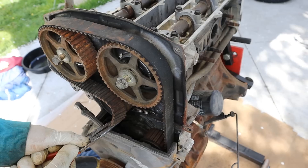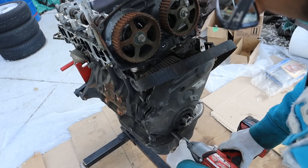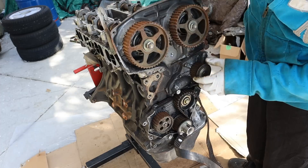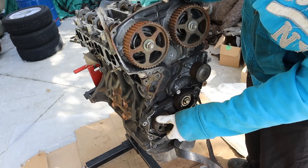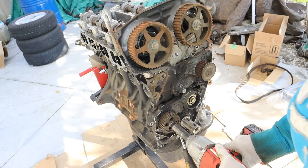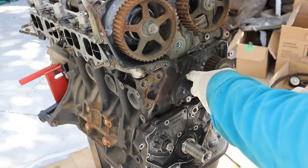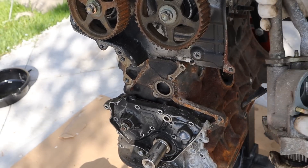I'll use the timing belt removal tool and the crank pulley removal tool. Taking a look at the timing belt setup: at the bottom we have the crankshaft, then an idler pulley, the water pump, the tensioner in the middle, and your intake and exhaust camshafts. Down here we also have another pulley for the oil pump. I'll remove the idler pulley and oil pump pulley. Down in this section we have what looks like the oil pump. Now I'll remove the water pump bolt — the water pump is actually part of the thermostat assembly, coming off as one entire unit with two pipes for the bypass.